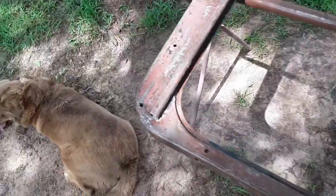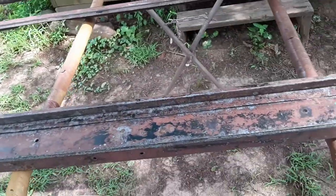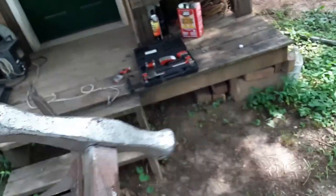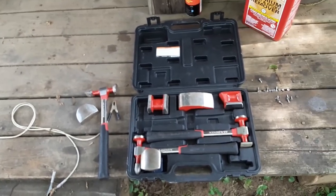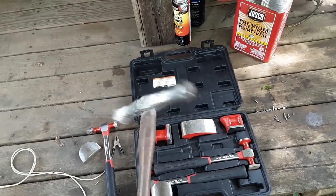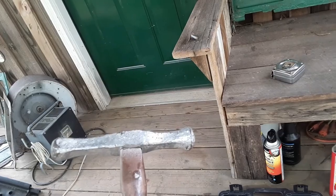That's because it was round. If I'd used the flat one I would have been putting Bondo back in the spot. You can see how this area is raised a little bit — if I take this rounded hammer I can knock it right out. I've been going at these a little bit; I've got a few spots that are raised up I'm going to have to use this hammer on. That's just a little tip if you guys are looking for body hammers. Nothing wrong with these kits — they'll get you by, they'll get it done — but I found the rounded ones are the ticket. You can use a ball-peen hammer too. I like a body hammer — this is a homemade body hammer someone made, a blacksmith made it. It works.